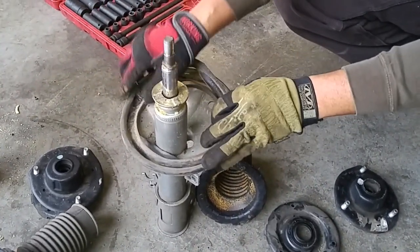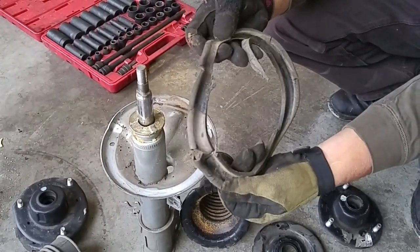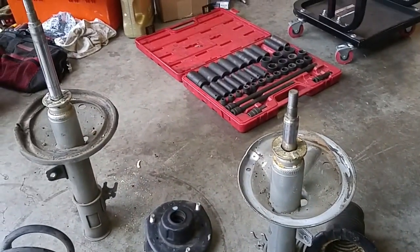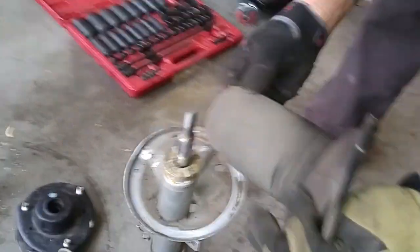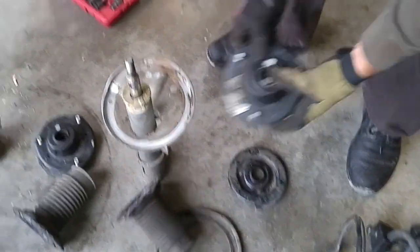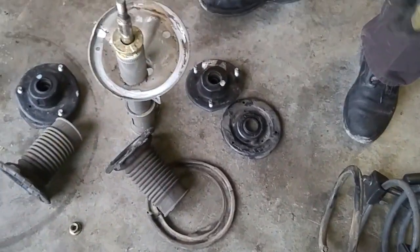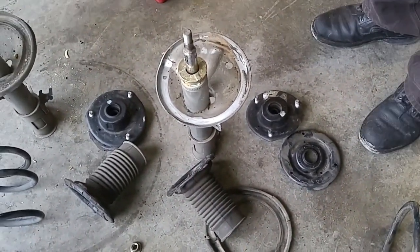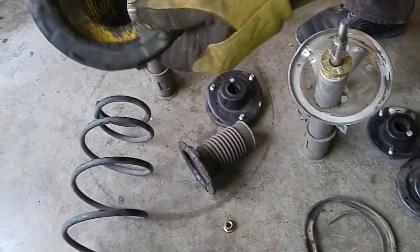This is your lower spring seat. If you're thinking about doing a strut replacement, you may have to replace the spring seat, the strut bellows, the upper strut mount, and if your springs have lost their tension you may have to replace the springs. You're just better off buying a whole new strut. The bumper is just totally dissolved — it just disappeared.